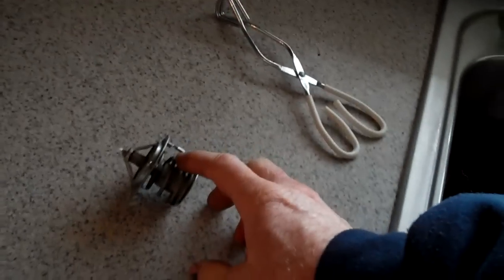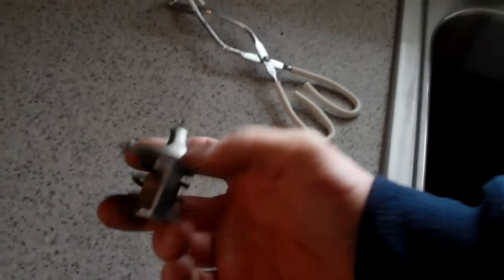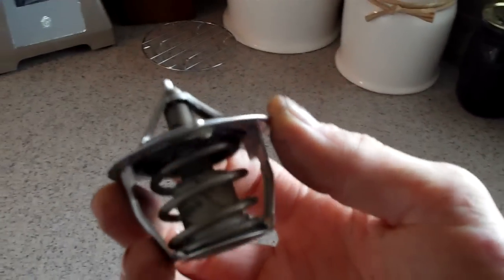If the car runs too cold, it won't be very efficient — you'll have excess emissions and hydrocarbons. Run it too hot and you'll ruin a head gasket and have other problems. That's why we use a thermostat. Companies have tried electronic thermostats, but with all the temperature cycles involved, they just don't work very well. The mechanical design has been tested and proven.